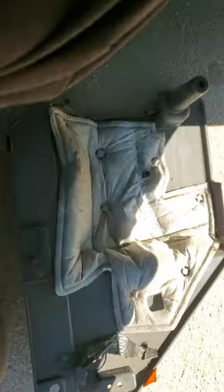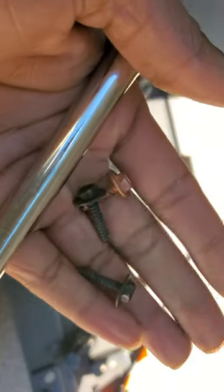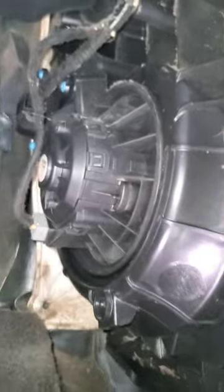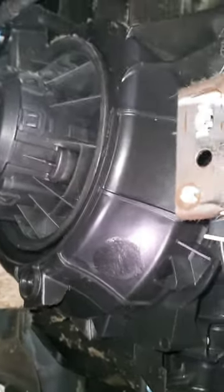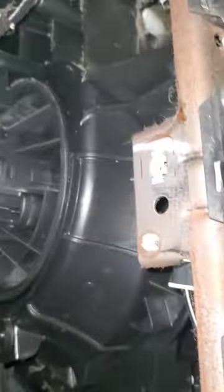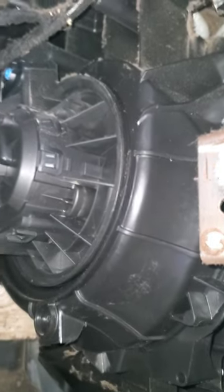Alright, Road Design, y'all. So it has an access cover — this little black cover right here — to access the blower motor. It's held in by three 7mm bolts. Get that out the way. Now we should be able to see the blower motor right there. On this blower motor, we have to disconnect the electrical harness and take out the 6mm bolt.